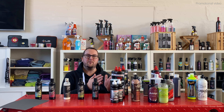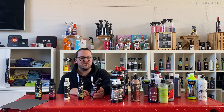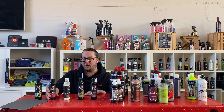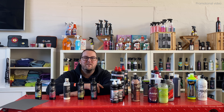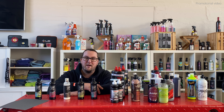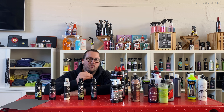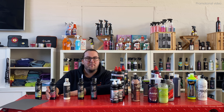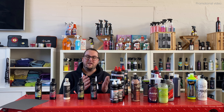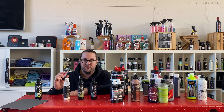Every dedicated polish will be better at removing paint defects. A glaze — which we'll talk about in a minute — is better at filling paint defects, and a protective product such as liquid waxes is better at protecting. That's why these products are often referred to as 'cheater products' — they have a place, but mostly when you don't have the time or budget to do things properly. By properly, I mean you reduce or remove paint defects with a polish and then protect your paint. It gets even more complicated because there is no universal way these products are defined — some are rather good at polishing but weak on protection; others are comparably good at filling or protecting but not great at removing defects. You have to check reviews and tests to find out which suits your demands best.